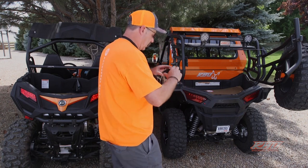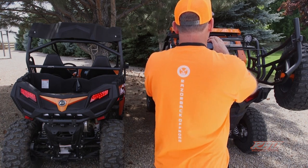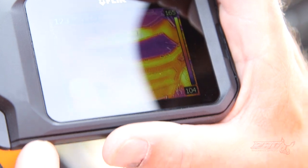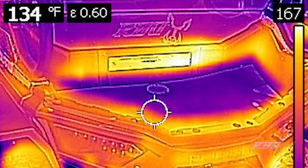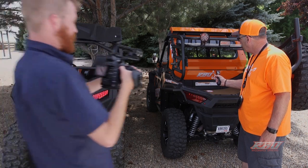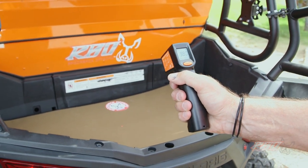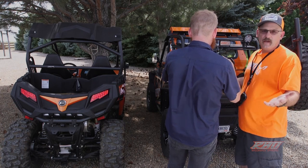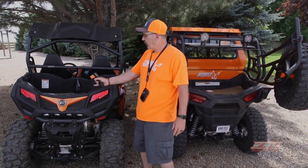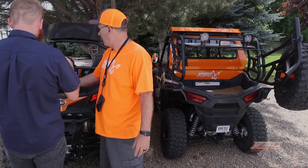As the temps start building, we're going to take another thermal image — and you can see the hot spot all around our pad. The yellow is where it's all hot, up to 122 degrees, and you can see the purple section is where our Rough Rider heat shield is. Taking the thermal gun now: a little earlier we were up in the 130s to 140 degrees, now we're down to 99 degrees. The reason it's 99 degrees on top of the Cordura is because it's 99 degrees outside — it typically runs at ambient temperature. You can see the pad on the CF Moto is also running at about 99 degrees.